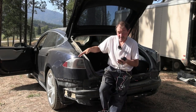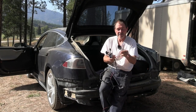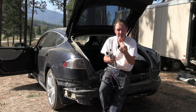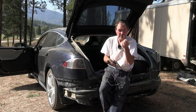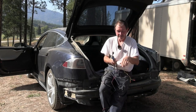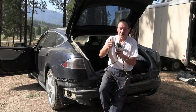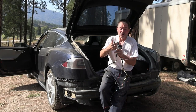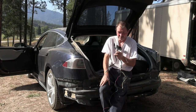If I set the left turn signal, since my left is yellow and my brown is taken from the left tail light, then this brown wire gets a blinking signal. So when I set the turn signal for the left, the brown as well gets a blinking signal. So I get an output to the trailer for my left as well as my brown for my lights, and all the lights on the trailer will flash, all of them.